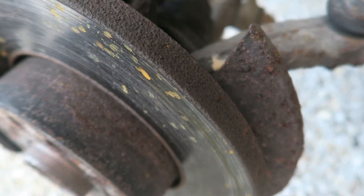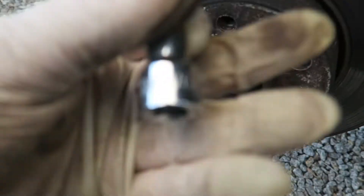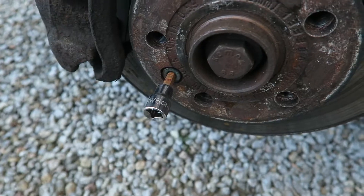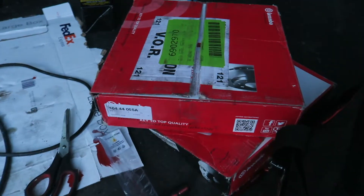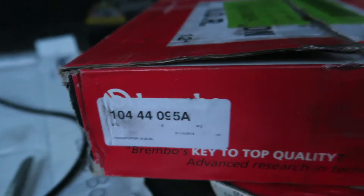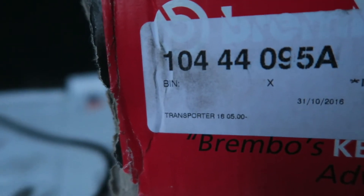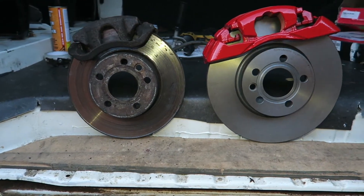The standard discs are just a solid one-piece disc. Undoing it — HW6 — undo that, get the disc off and see what we've got. Brembo discs, 104-44095A — they are the 313mm discs. You can see there it just says transporter. So there they are side by side — big size difference.